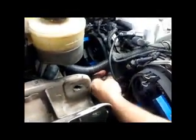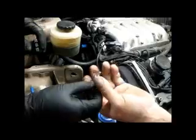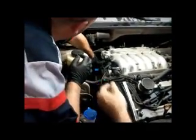Simple as that to hold the belt in position. Now we have the clip on, holding the belt on the cogs of the cam gear temporarily, until we get it around every gear and idler where there is no slack, no play. The play will be on the back side of the belt where Hector is installing the belt tensioner. I leave one on the back there until we get the tensioner on it.